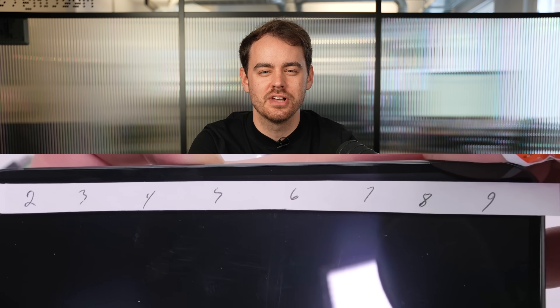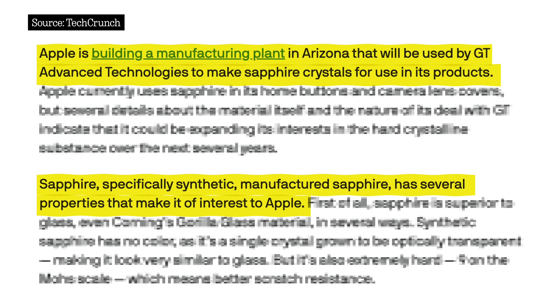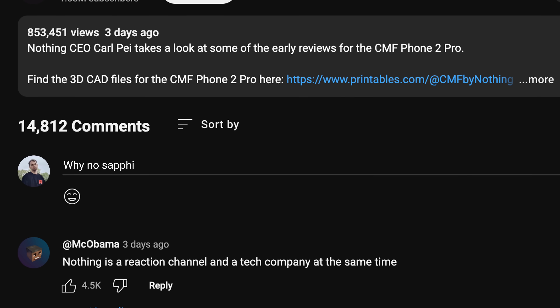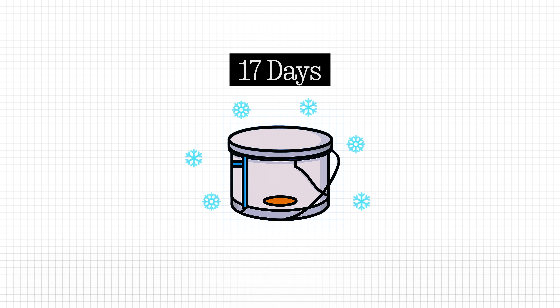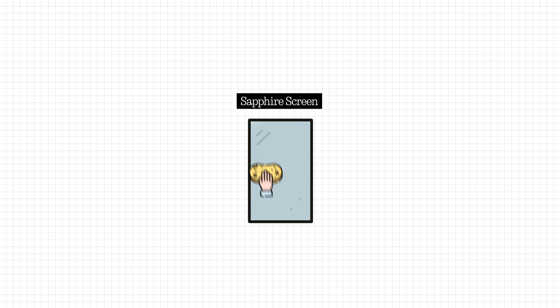The most expensive part of Zach's phone: the sapphire glass. We all know that regular glass and Gorilla Glass scratches at level six with deeper grooves at a level seven. Zach wants to remedy this, and his solution is sapphire — normally reserved for high-end watches. It considerably outperforms regular glass in scratch tests. Back in 2013, Apple actually signed a deal for $578 million with a sapphire manufacturer. At the time, it was highly anticipated that Apple was going to use sapphire crystal on the iPhone 6, but over ten years later we're still yet to see a single iPhone with sapphire crystal on their screens — a privilege reserved for the Apple Watch lineup. The manufacturing process requires mixing synthetic sapphire and aluminium oxide and heating them to about 2,200 degrees before embarking on a 17-day cooling cycle, resulting in a large crystal known as a boule, which is then cut into screens and polished to make it as clear as glass.